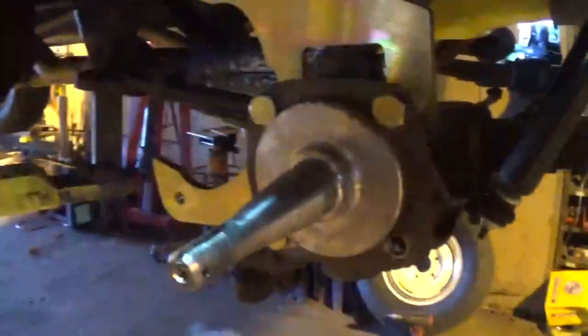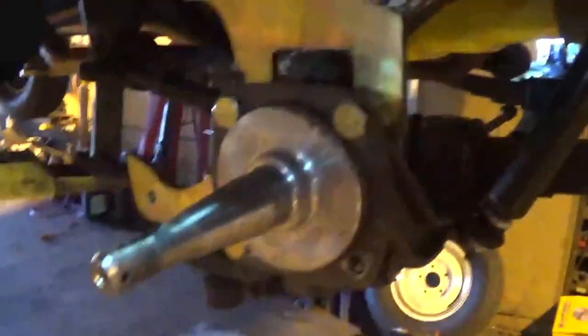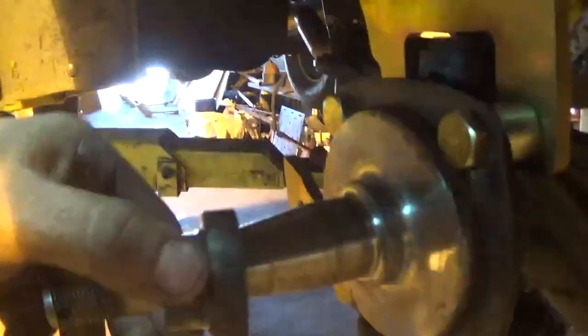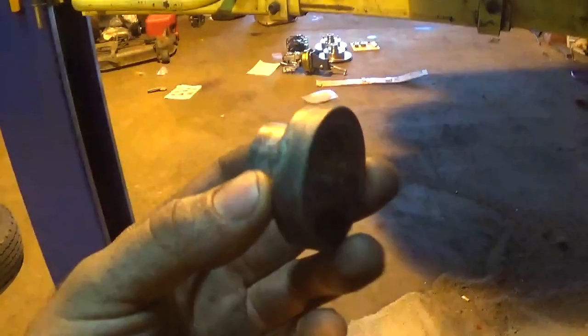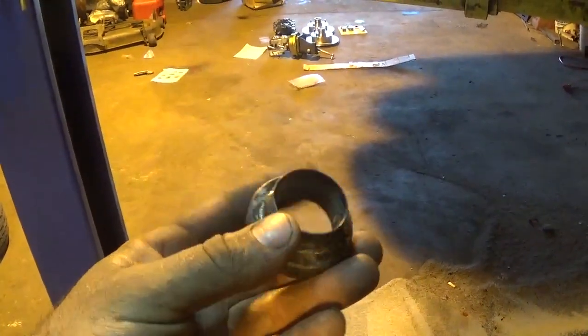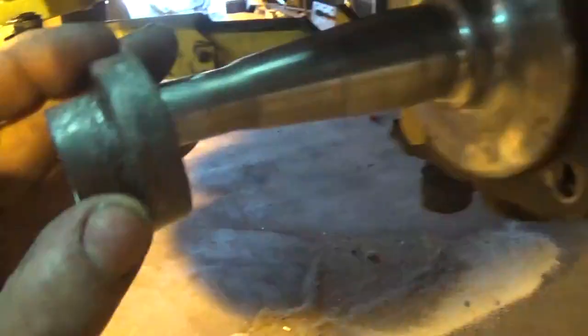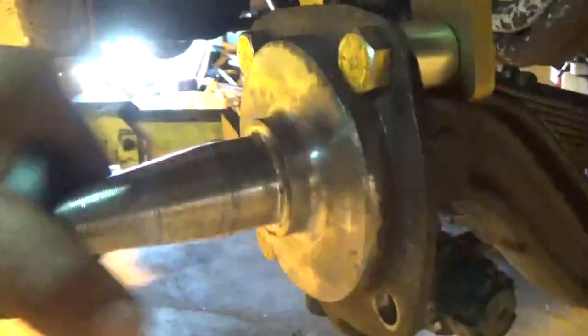I did go back and heat that a second time. Now it's tightened up nicely — a nice press fit. I'll buff the bearing surface and seal surface a little bit after I install it on the spindle. Now we have a nice tight lock on that spindle.